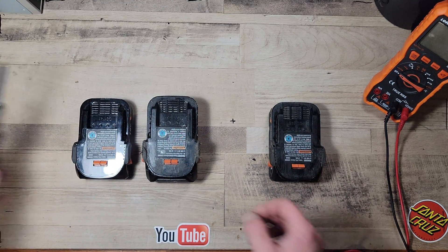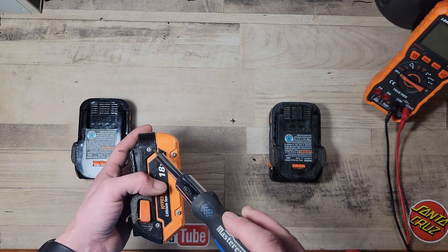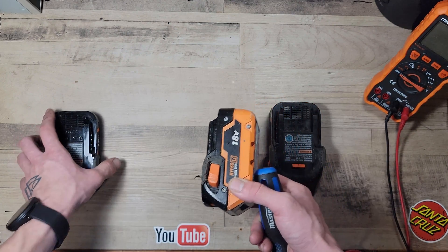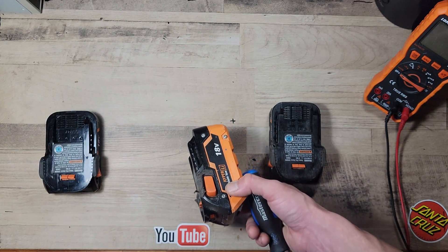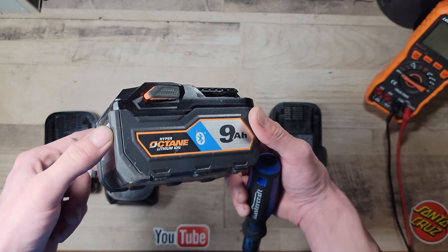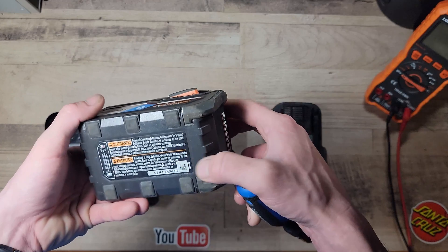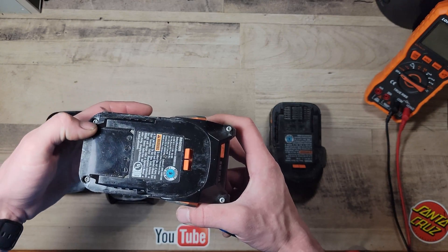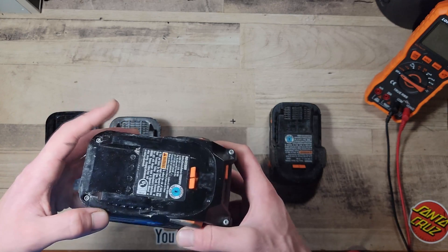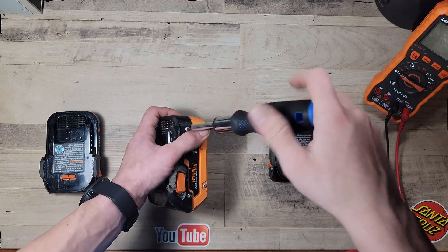To start this project, you're going to need a Torx T10 to take out the screws. On these larger and middle-size batteries, the screws are on the side, same as the small batteries. When you get into some of the larger Rigid batteries, the screws are on the top. In your case, you may have a battery with no screws on the side — for example, the Hyper Octane Bluetooth 9 Amp Hour has no screws on the side or bottom, but two screws up top under cap plugs. Those four screws disassemble that battery.